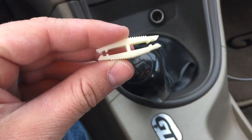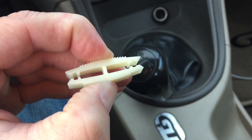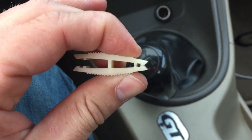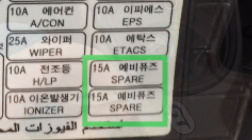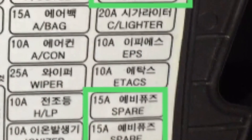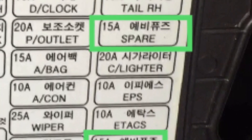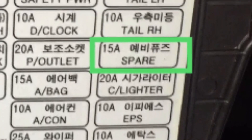It's always good to have a pair of needle nose pliers handy for that. Some cars come with a fuse puller, but it's kind of hard. Something else to mention is a lot of times, like in this case, the car comes with some spare fuses. So where it says 'spare' on the plate on the back side, you can use those usually. We were able to do that, put everything back in, and everything works as normal.